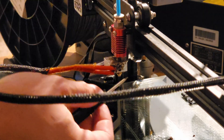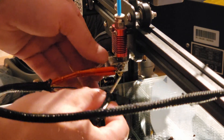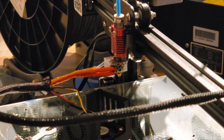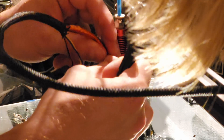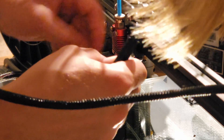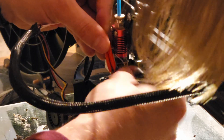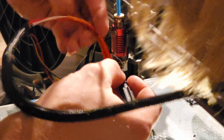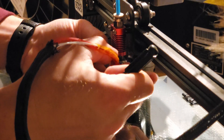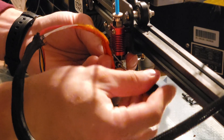There are two holes — there's a big hole above and then a tiny hole right below it. The tiny hole is where the little glass bead goes and the big hole is where the screwdriver goes. We're going to bend these wires so the bead is going where it needs to be. You can get the screw in the hole and just start it just a little bit, then you can work stuff around — screw is in the hole, bead is in the hole, and then you wrap the wires around the screw.